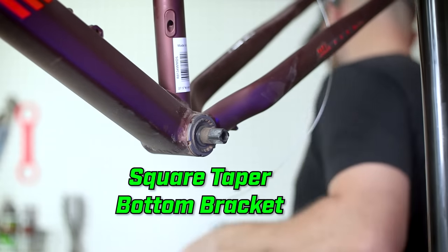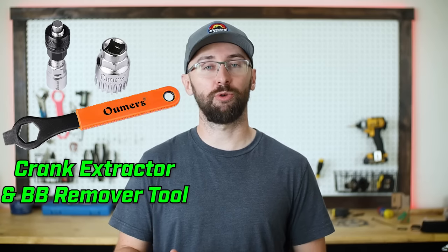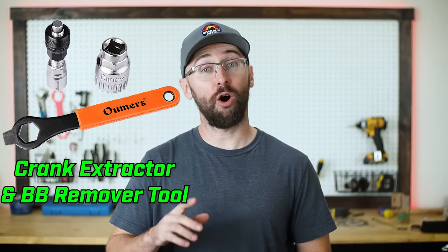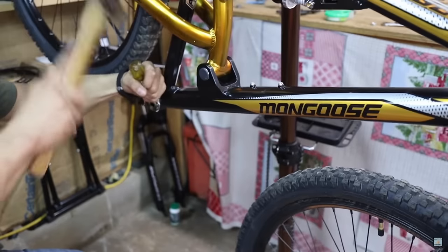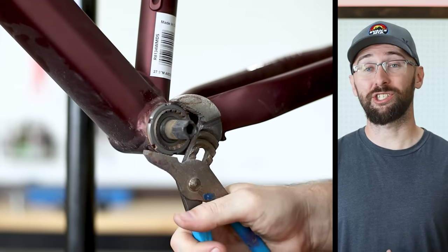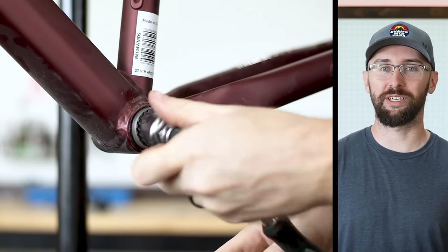All the big parts are removed and there are just two things left that can be pretty difficult to take off. This one is called a square tapered bottom bracket. The stock bottom bracket won't work with the cranks I'm putting on because the cranks have a large through axle and use external bottom bracket bearings. I recommend a specific tool for removing the cranks and bottom bracket, though you can get creative by grinding a slot in the bracket and using a big pair of pliers — although you will ruin the stock bottom bracket. This tool is only $12 on Amazon and is totally worth avoiding the hassle. Link will be in the description.